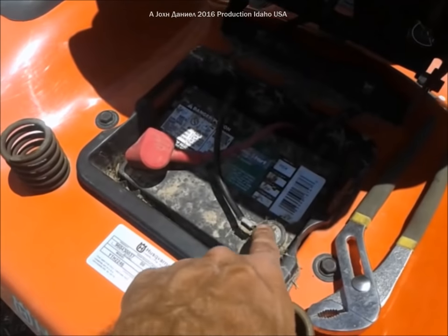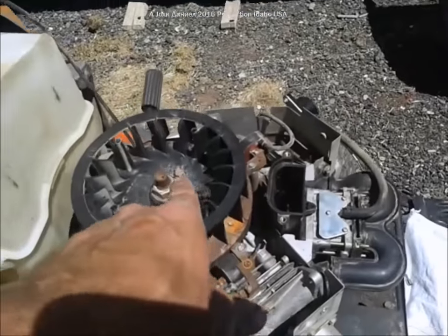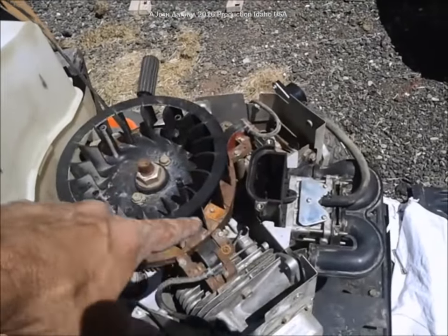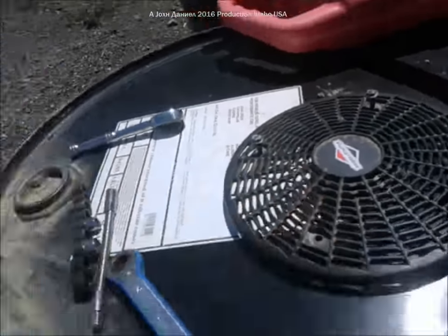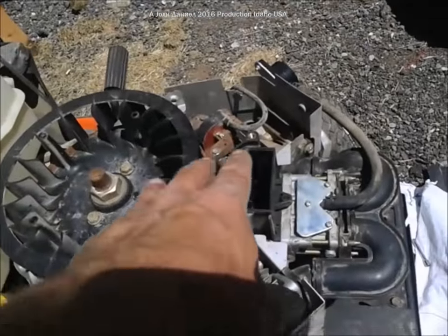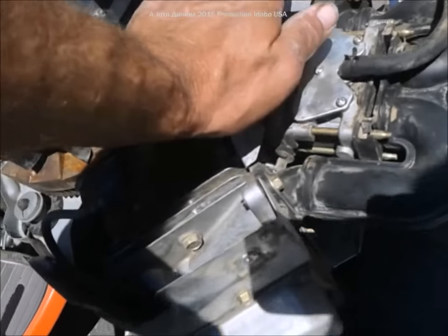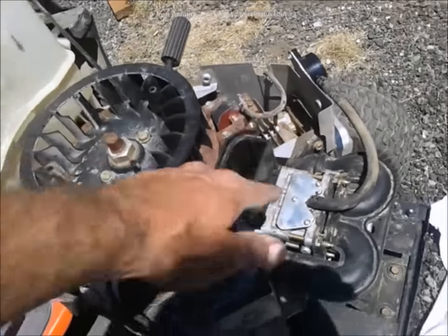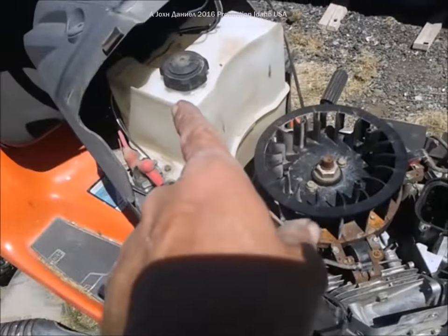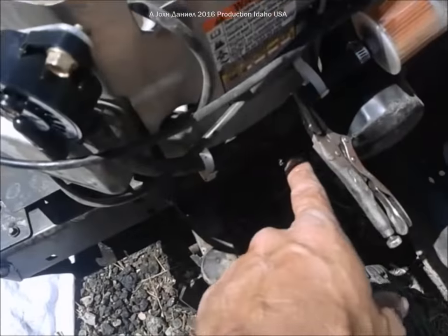You want to make sure you take your battery loose on your mower. You'll be taking your shroud off of it, including its fan guard — this is the fan guard — and you want to make sure everything is clean. You want to cover this up, blow it out real good with air to make sure you don't have any debris going to end up in your carburetor. Disconnect that battery and put a clamp on your fuel line.